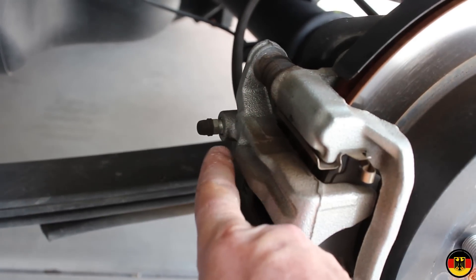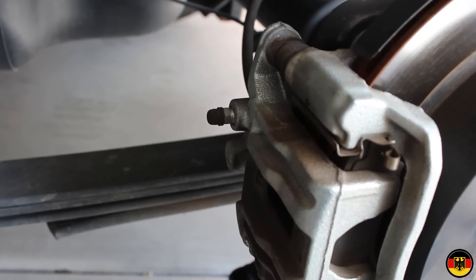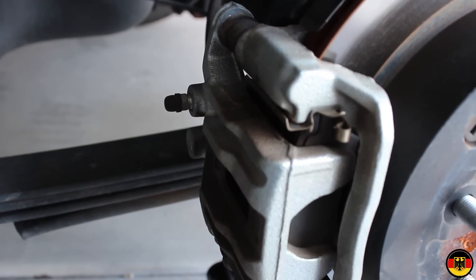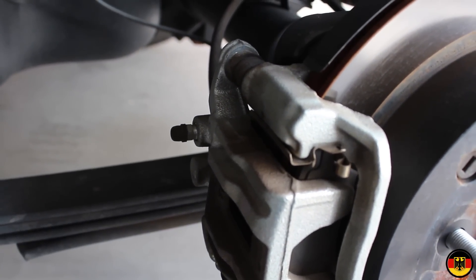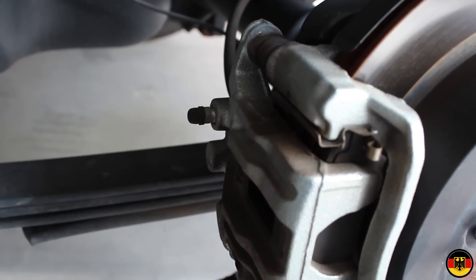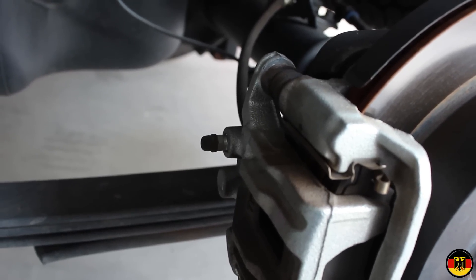Right here is the rear bleeder screw — same as the front. It's going to get seven Newton meters of tightening torque. We're going to loosen it with a six-point socket and then bleed the brakes the same way I described. I'll Armor All anything in here that has rubber bushings, and I'll torque the wheels back on to 98 foot-pounds. Just make sure you don't bleed the reservoir down to the point where it gets air in the lines, and make sure you close the bleeder before the person in the truck lets the pedal up, otherwise it'll suck air back in. If you're careful of those things, it's a pretty easy job — takes about an hour and a half to two hours at home with regular tools. If you had a lift, you could do it in 20 minutes. Thanks for watching.